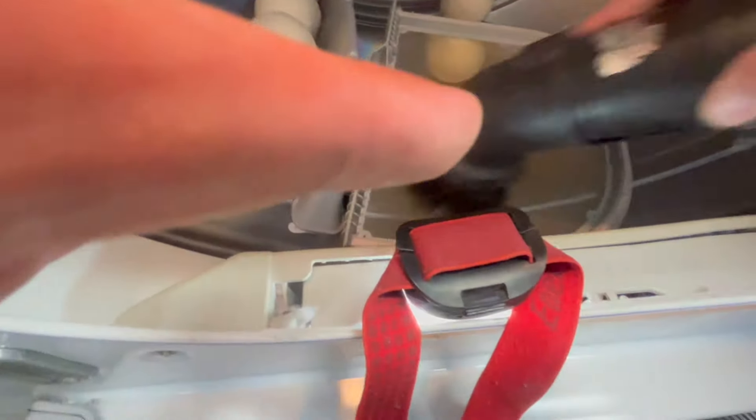I'm just vacuuming off the lint tray — that's the easiest part. I shine my light in there and start with the thin attachment to get all the loose dust and lint out. Then I use this thin screwdriver-like tool to get into the little crevices, because sometimes lint gets in there and it's impossible to get out with just the vacuum. You could use a flathead screwdriver. Then I go in with the brush to get the sides.